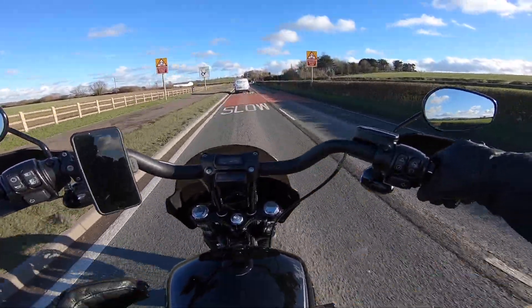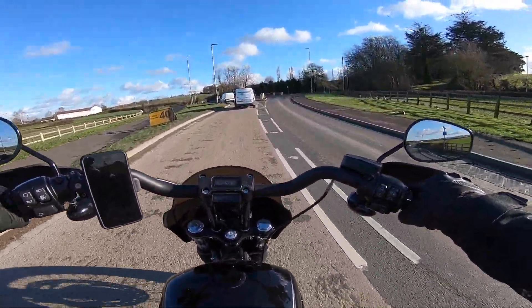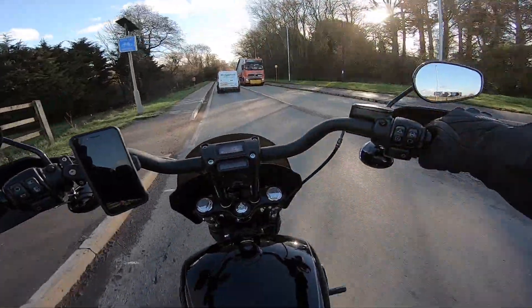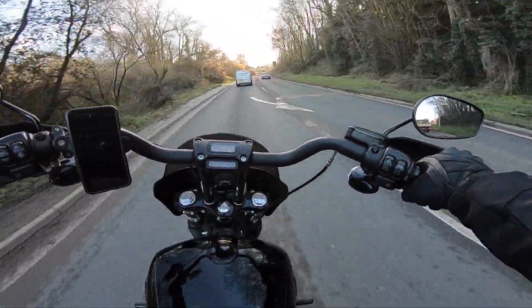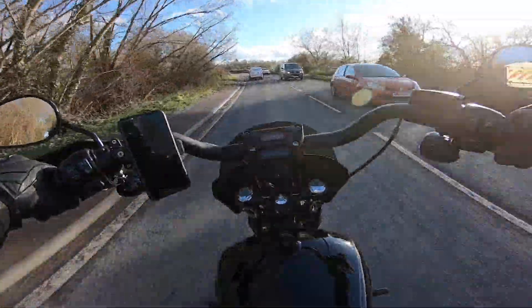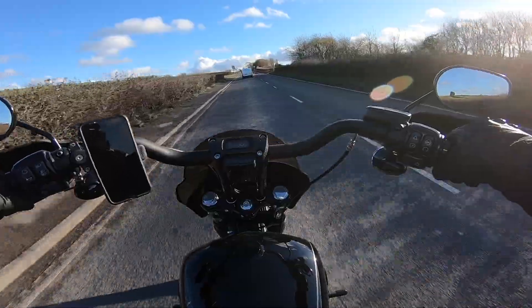Basically you get on your bike and ride — pick a decent route with lots of bends and lots of straights. You really want to wear that tire in. Just take it easy: don't go trying to get your knee down on the first bend, don't pull away too hard on roundabouts. Try and find something quite bendy and just progressively wear those tires in over a hundred miles or so. You'll know when they're done because the smooth finish will go and they'll feel and look grippy. Don't think you can just go on the highway for a hundred miles and say you're done — you'll point it into a corner and just slide out.